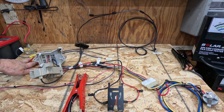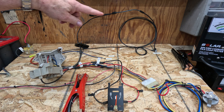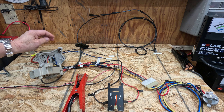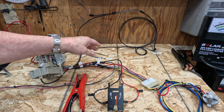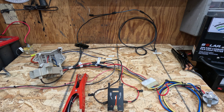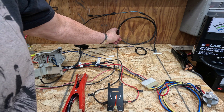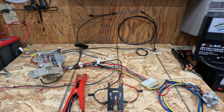This retains stock circuit protection, as opposed to the so-called shunt wire bypass we're looking at in the other videos, which bypasses the protection of the fusible link. This makes the system — or rather retains the system safety — as it was designed. It also doesn't affect the ammeter performance; the ammeter still registers battery charging current only. It's a better alternative to any of these shunt wire ideas that are kicking around out there.